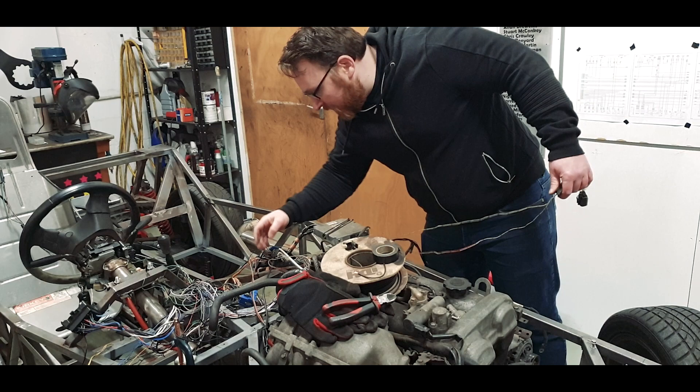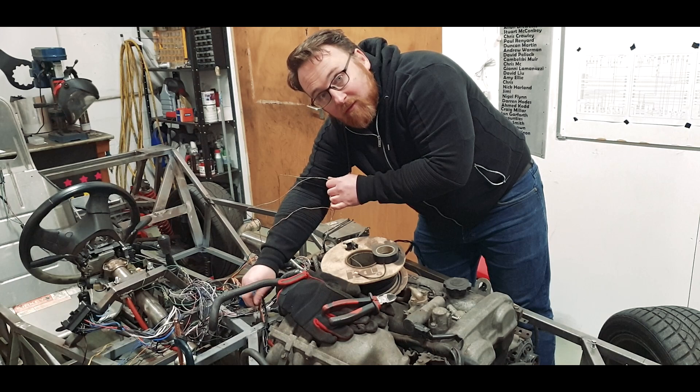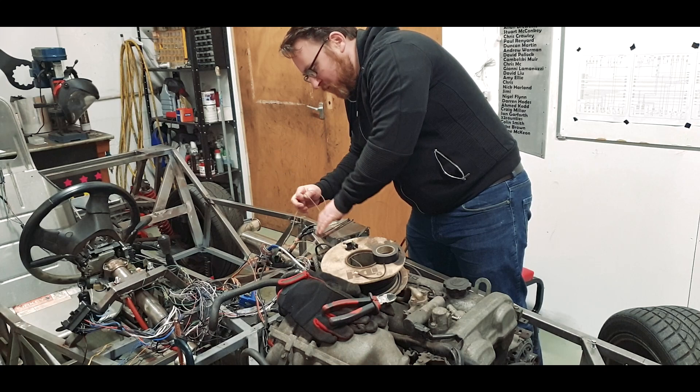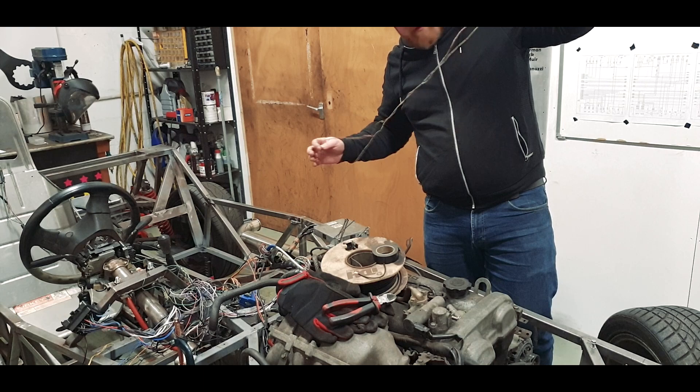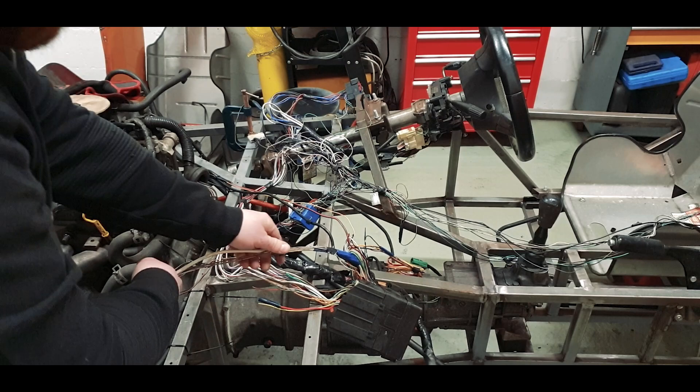With this apart, we can now untangle it, trace it back down along the white wire and the route it should take. Once I've done that, considering I've already chopped this, I'm going to re-length it so that it matches and then we'll tape it back up again. That's just going to make things so much more neat. This is a prime example - why is this wire joined with another one? We're going to wind up from here and length it properly at the termination end.